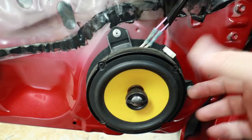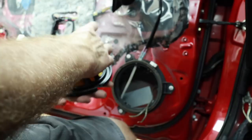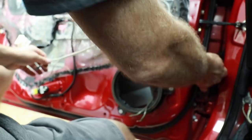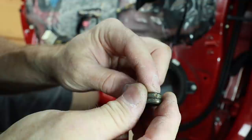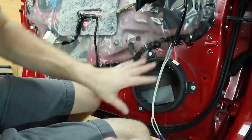The speaker is mounted to the existing factory speaker location — they just used three drywall screws to pull it out, no terminals, just wires twisted in. These are some more JL C1s. We'll have to fix the boot and pull this wire all the way out. You can see where the metal from the boot has been rubbing on this wire and has already cut through it — one is cut through and the wire is exposed. So this was already shorting out in the door. The only thing stopping it was the paint on the open wiring right there. And this is crappy copper wire — you can already see where it's corroding in the harness. Not all copper wire is created equal, guys.